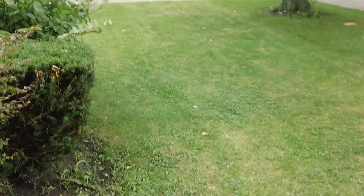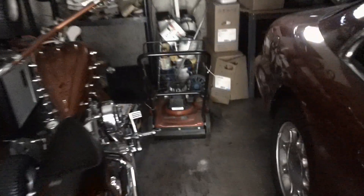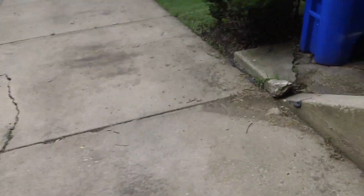Let me come up front and show you guys my mower and what we're currently doing to it. My Rally mower is developing the same problem that a lot of these mowers do at this age. We've got the starter taken off of it, and it's been developing the classic surging problem because the carburetor is dirty — apparently a common problem on these. The engine surges up and down, so we've got it all apart and we're going to clean the carburetor. Currently that one is not working, which is why we bought the one out back.